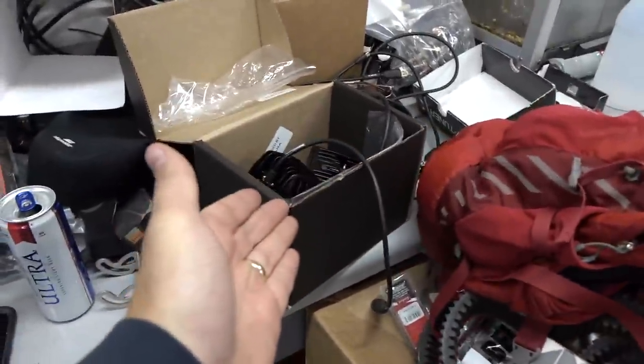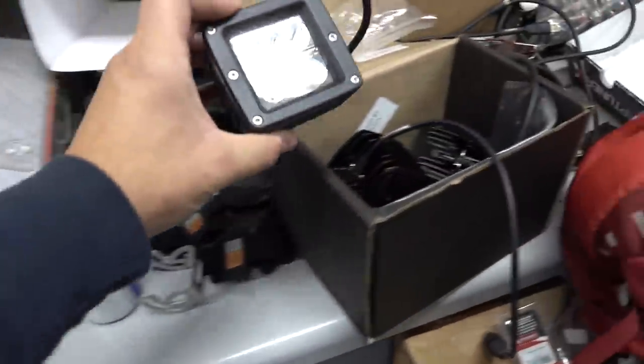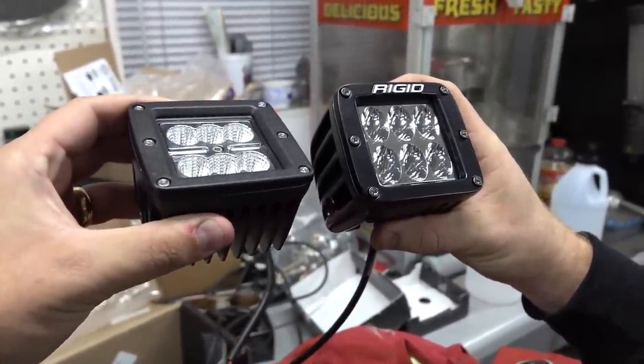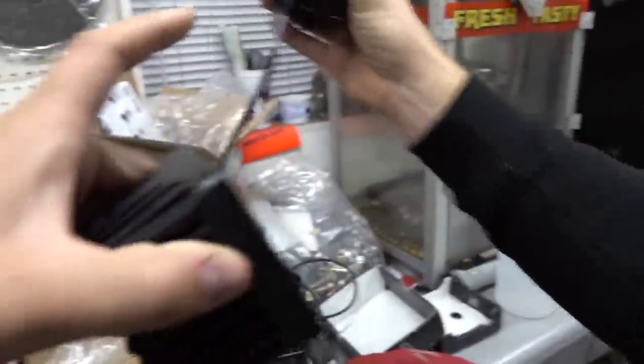Got from a friend a pair of rigid pods, and from another friend a pair of China pods. So we've got four pods total. Beast Mode gets some real headlight issues from certain rides - one is basically just full of mud 100% of the time. Since we're going to Camp Razor and doing some night riding, it needs headlights that actually function. So instead of putting stock headlights in, we're going to combine our rigid pods and China pods - rigid on the outside, China on the inside as the high beam.